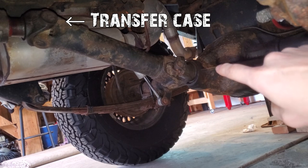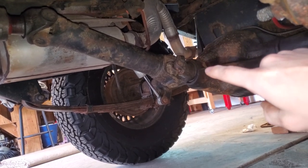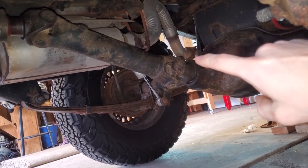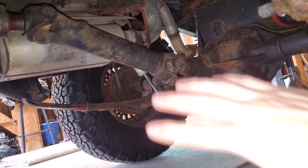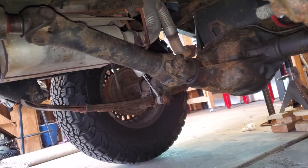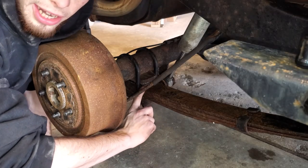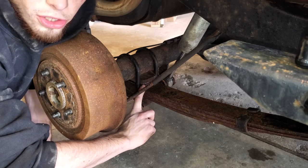I've been driving it like this for a couple of years now, and I've noticed some shudder or movement when I start to accelerate — that's probably what's going on. Now that I'm older and wiser, we're going to fix this as fast as we can. We've got a shim right here, and it's at a slight angle — hopefully roughly the same angle that's causing these issues.